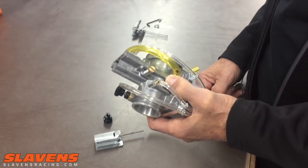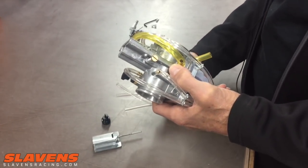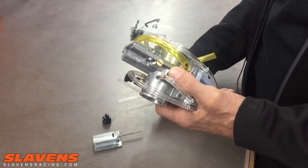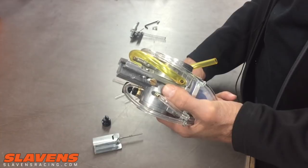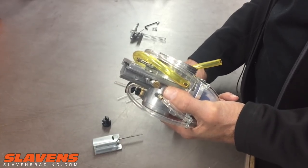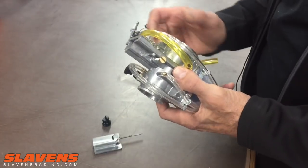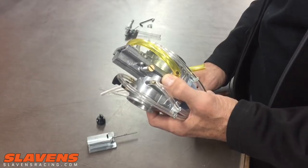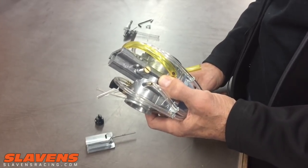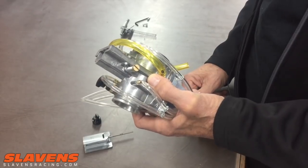Also, make sure you're tuning a good platform. By that I mean, is your engine in good condition? Guys tell me all the time they've got 250 hours on their piston and just put on the carburetor — well, you can't tune worn-out engines. So if your spark arrestor's plugged up, if your engine's tired, or if you've just changed 20 other things on your bike, well maybe it's not a carburetor issue. Do one thing at a time.